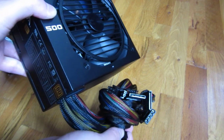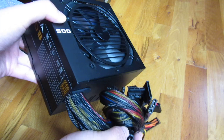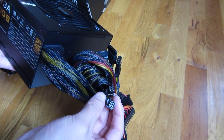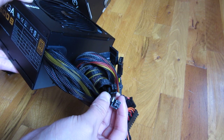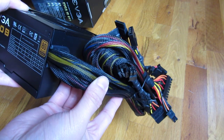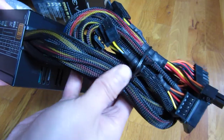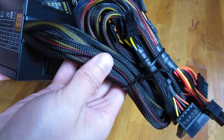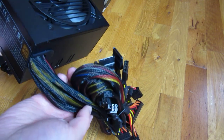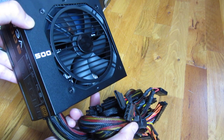What I was most concerned about was the CPU connector — the 4-plus-4 you see here. It was better for me to just get a new power supply rather than what a lot of people suggest on forums, which is to just stick the 4-pin in if you don't have a full 8-pin. That should power your CPU if you don't overclock, but personally I'd rather spend $30 on a new power supply and have the proper connection. The wires are nicely sleeved in nylon, so it's pretty high quality for a cheap price. Thanks for watching.